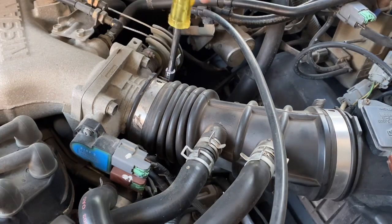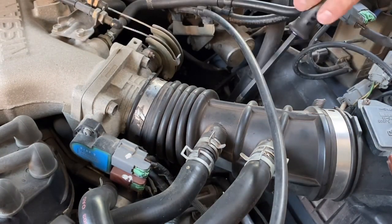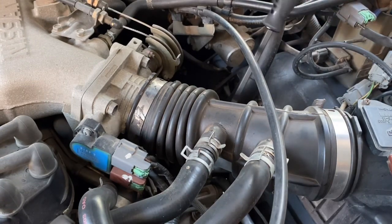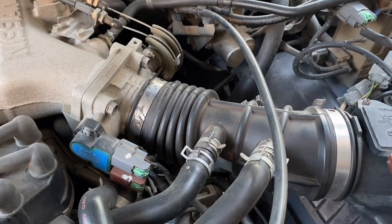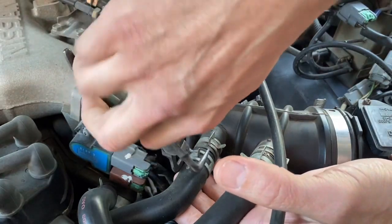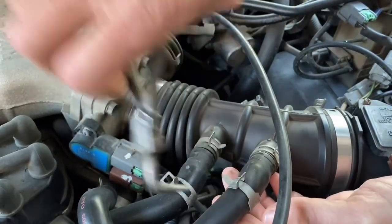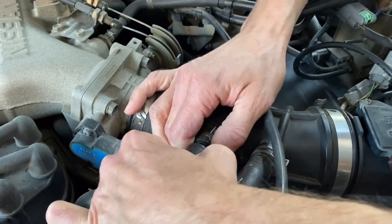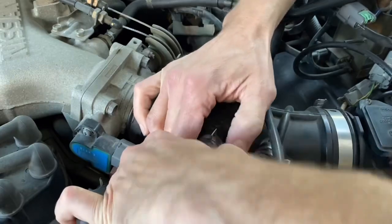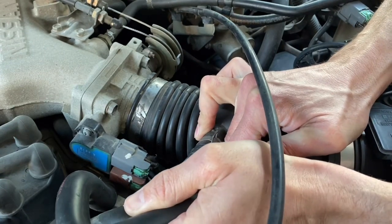There are a few things we've got to loosen up. Obviously the one that goes right here, we have to loosen up and we're going to be taking that one off. We're also going to loosen this one up right here — this goes to that secondary little air box. Loosen it until it starts moving around. The next ones we're going to loosen up are these. We're also going to be taking the mass airflow sensor loose — it's right over here off camera. Let's go ahead and take these off.